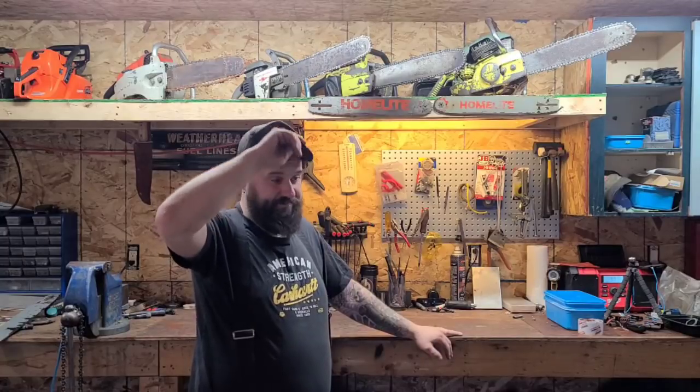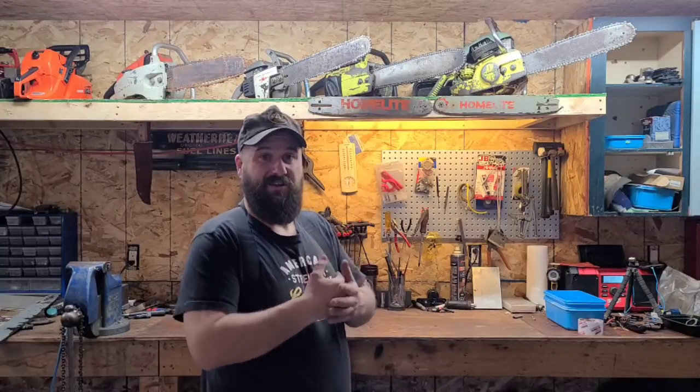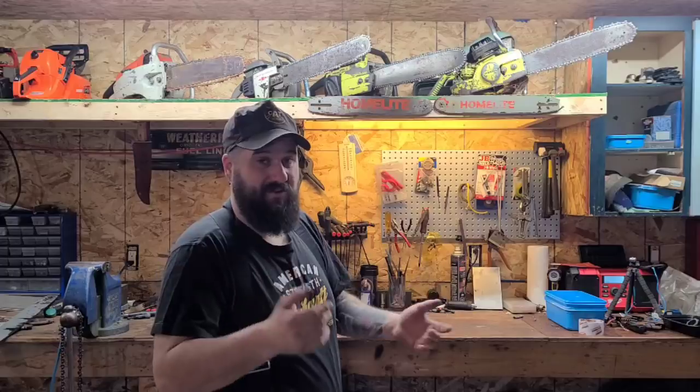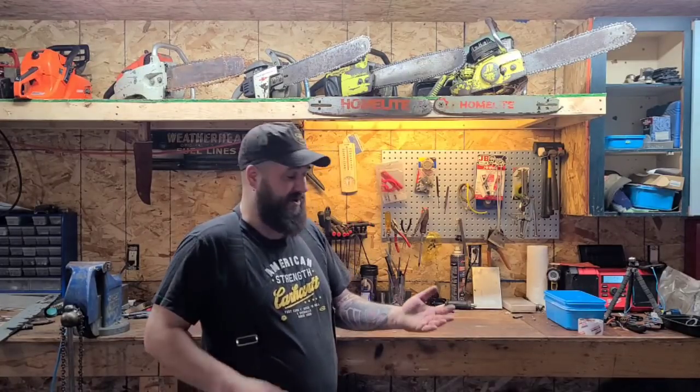Just keeps me cool. So yeah, again, that saw runs so much better with that chip in there. It's incredible. I wanted to go through and show you guys the deal with that, and then just let you guys know and install it. There's other videos out there, but I wanted to install that on video and show you guys where the wires go so that there's no confusion. And again, it was just that simple. You can either leave the points on or rip them off, and that was that. And the starting warm, that saw starts beautifully now. So I'm anxious for Buckin's feedback.